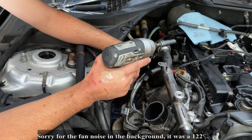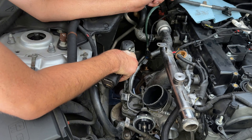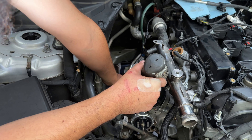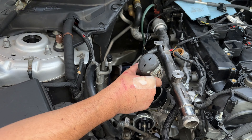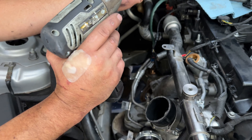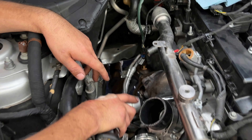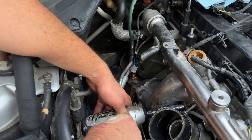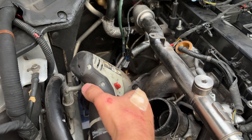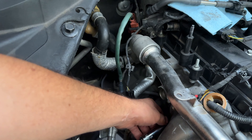This is the worst place you want that to happen. This feeds coolant to your turbo and cools it down, so if it breaks — bye bye turbo and you will cry. Now we got to get the weight off from the mount. That's the weight to the mount. Next you're going to take a 13 millimeter — that was a 10 mil, now we're moving on to 13 — taking the nuts from the turbo.